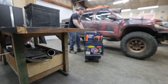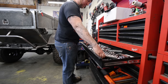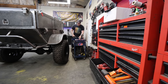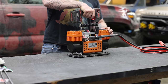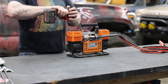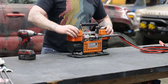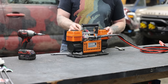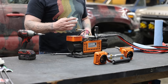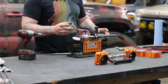Clearly, these Maxi-Track compressors leave a little bit to be desired, but for the price point I think they're very hard to beat. And if you're a guy like me who likes to tinker, this is such a great opportunity to have a fun little project. You can experiment with different ideas and see how far you can push something like this on a budget. Once we troubleshoot this noise and fix this leak, I'd like to experiment with opening up some of the internals and see if we can get more flow just by opening up some of the holes that came from the factory — pull more air in, which would hopefully push more air out.